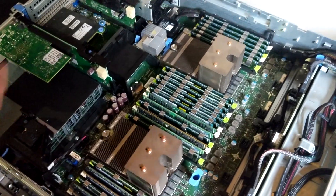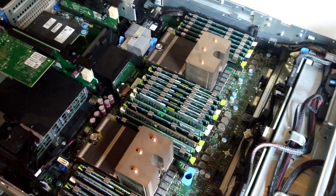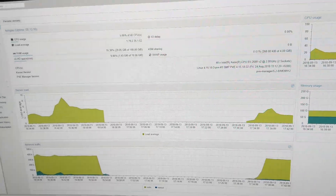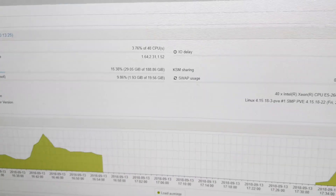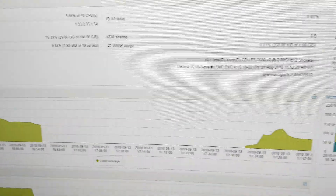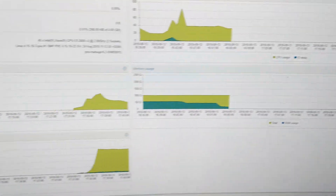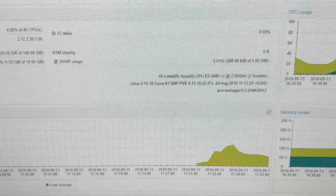Both CPUs in and all the more RAM in. So we have in this system now 20 cores, 40 threads, 192 gigs of RAM. Let's see how this runs and let's put everything back together, fire it up and see what Proxmox sees. So after that we can see Proxmox is booted — this is the Kongu node which is the one I upgraded — 40 CPUs, that includes the hyper-threading. I've got all my VMs running and I'm hardly putting anything on it. As you can see, 40 times E5-2680 V2s, 188 gigs of RAM because of how memory works. That's a hell of a machine now. Thanks for watching, if you liked it give it a like — I'll catch you in the next one, bye.